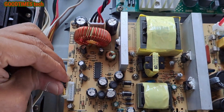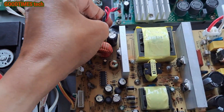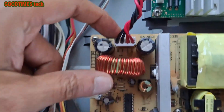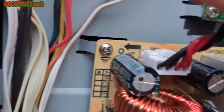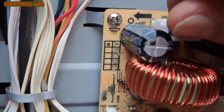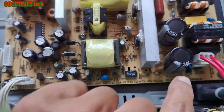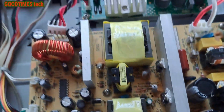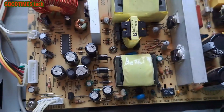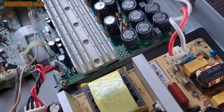See if they have been glued — if they are glued, just remove the glue first and then pull them gently. Here there is a lock — you see there is a lock here — push that lock and pull the connector upwards. Same thing here also and here. Take a Phillips-head screwdriver and remove all the screws.